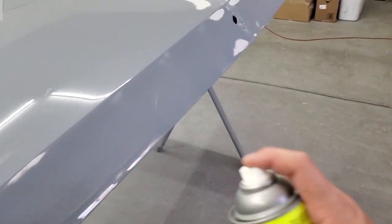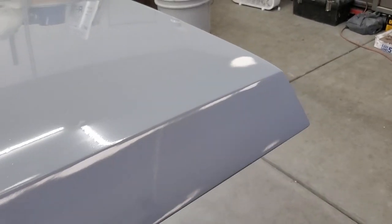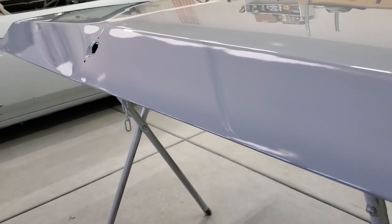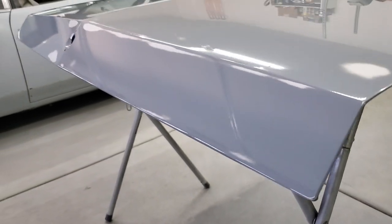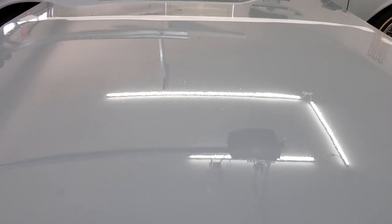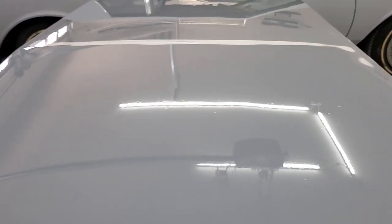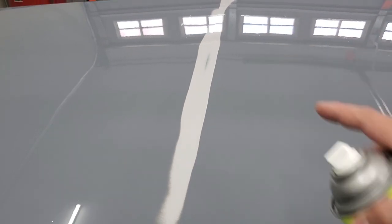This quick spray is real good. It says it's okay to leave it on — it evaporates and dissipates on its own. It doesn't smell either. The panel looks pretty straight. I did some body work here and it looks good to me. In the middle there, that's where the body line is — that's why there's some distortion, but it's from the actual body line that runs all the way straight back.